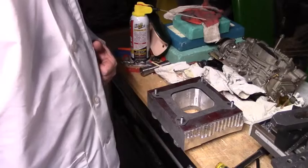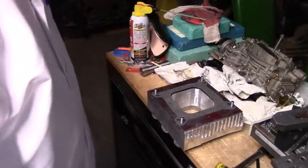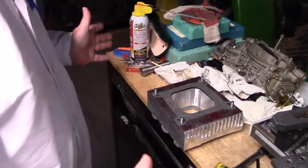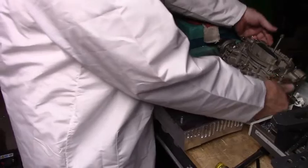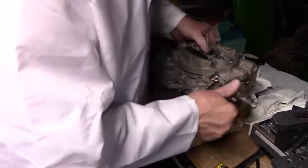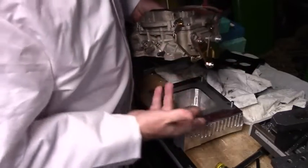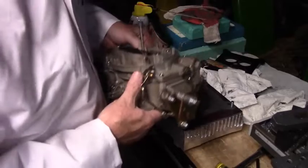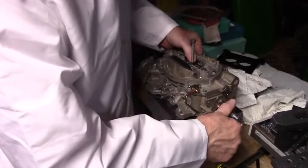I am glad that I decided to dry fit this, especially with an AFB. I was always curious about just how far out I had to go before I interfered with some linkage or parts of the carburetor that were sticking out. The linkage will need some room to drop down, so not all of this was going to be here anyway, but it will change a little bit of the looks. I don't think it's going to affect the outcome of the performance.